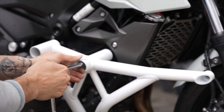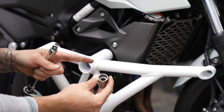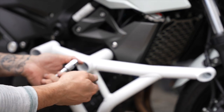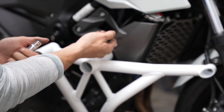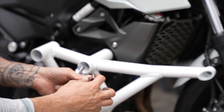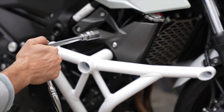So that's the issue — word to the wise. Do not use what I initially told you to use. Use something shallow with an extension, because I was trying to put pressure on the bolt to actually meet the threads and I couldn't because it was slipping all the way down that spark plug socket. So you need to use something shallow. Now I have this threaded in.